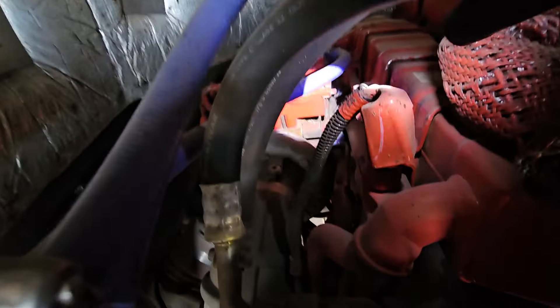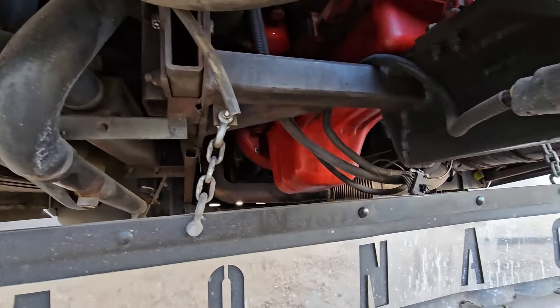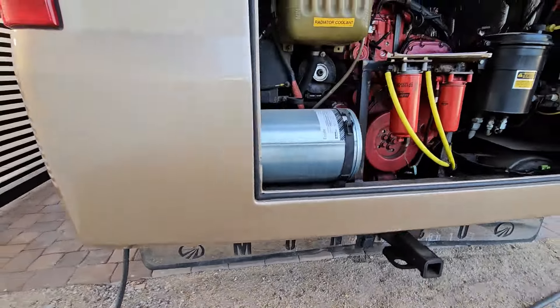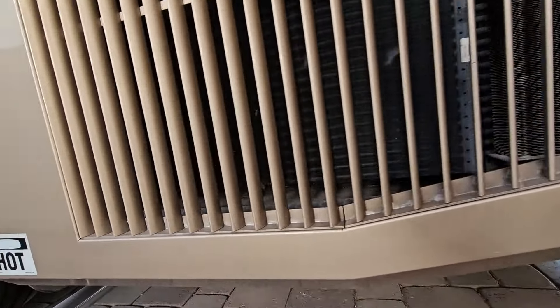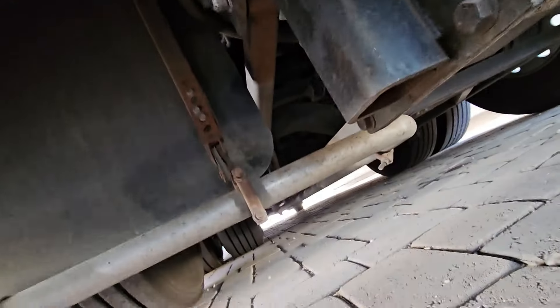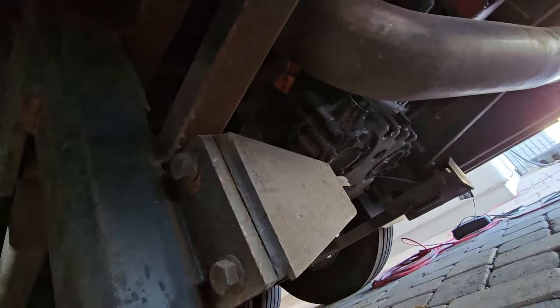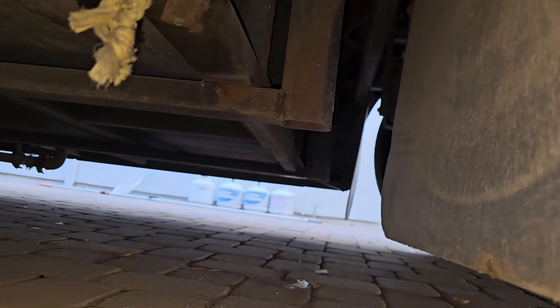I can't explain how important it is not to have a Navistar engine back here. This is pre-death, so 2011, and this is a Cummins ISL. We do want to look for any oil leaks, and the exhaust manifold likes to crack. These surge tanks also like to crack and have issues — it should be replaced with a metal one over time. It's pretty clean. This has a side discharge radiator; some of these Monaco radiators did have issues cracking. These also had some trailing arm issues on the rear axle — check that square tube to make sure it isn't bent or rusted. The chassis is a Roadmaster chassis with airbags on both sides of the axle.